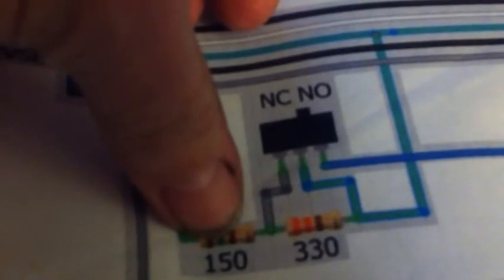All you have to do is take a blowtorch or something with enough heat, melt the solder, tap the pin out, redo your wires, stick them back in, and solder them down — you're good to go. Other than that, it's just about getting the wiring right: get a switch with a normally closed side to it that shorts out the 330 ohm resistor so the car only sees 150 ohms.